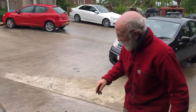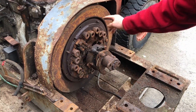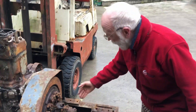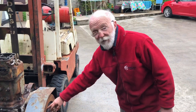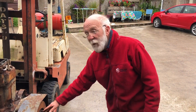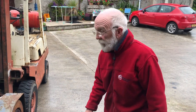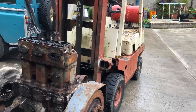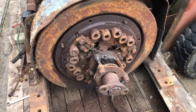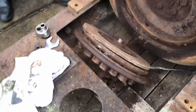So the drive plate — remember I explained about the drive plate and how that helped the crane to move — we've removed all the studs except two, and we're hoping this plate will just pop off. What normally happens is the plate gets rusted onto the flywheel and it might as well be welded on. I'll confess we cheated a bit by lubricating this beforehand. Good screwdriver in here and there she goes.